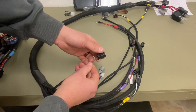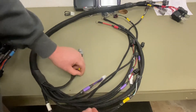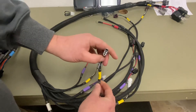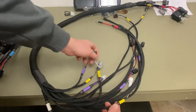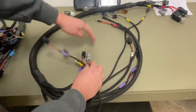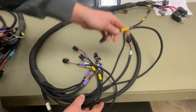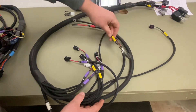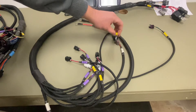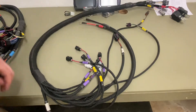It is ground activated because it's a blue output. Intake air temp — gen two Busa or GSXR, can be converted. Rear shock sensor — this is the rear shock connector for the FuelTech sensor. Gear position. Injector plugs. You have a wastegate or nitrous pressure sensor. You also have a pan vac sensor or back pressure sensor, which can also be used for another type of pressure — say shift pressure — you can just relabel it in the software. Same goes for fuel, oil, nitrous, and wastegate pressure — you can relabel them if they go to a different sensor.